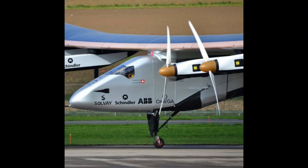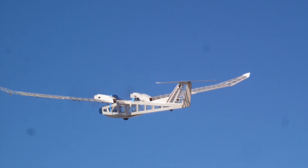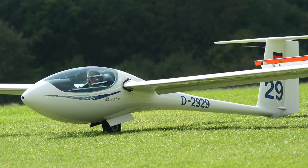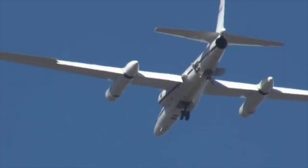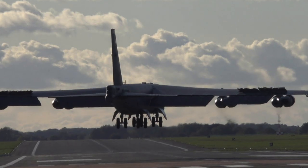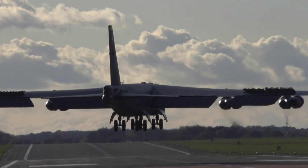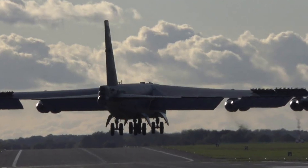We had some reason to think that this type of gear might be usable due to its use on Solar Impulse 2, from which Dragon had already taken much of its inspiration, and also the success of another large model we had built which used a single wheel on centerline. Sailplanes of all sizes also commonly use the single wheel configuration with good success. The U-2 and B-52 are also aircraft which use the inline gear configuration, the B-52's gear being capable of swiveling to compensate for crosswind conditions.